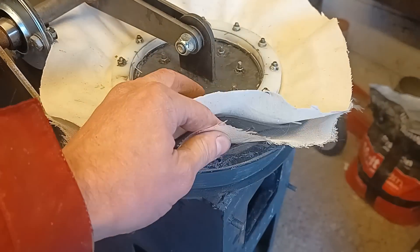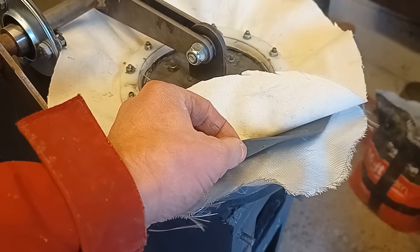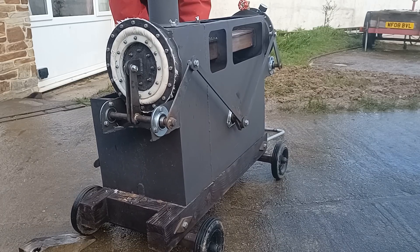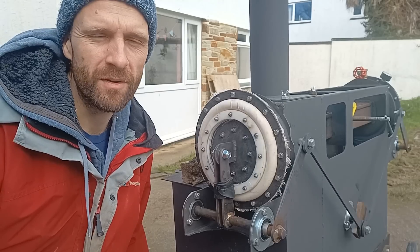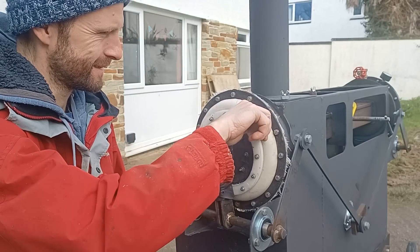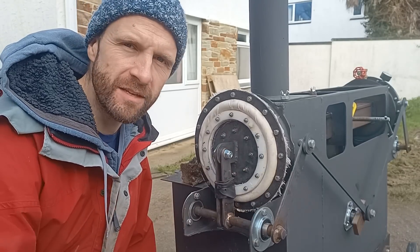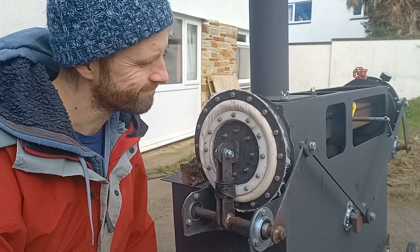This is the next one to try. On the inside I've got the fire blanket which is a glass cloth; in between I've got two-millimeter natural rubber; and on the outside I've got some cotton canvas. I'm hoping the cotton canvas will support the natural rubber from the pressures within the engine. We're up to an hour and a quarter now and still going strong. There was a bit of smoke coming off this earlier — I think it's because the natural rubber has hit its temperature limit, but the canvas is actually supporting it so even though it's probably breaking down and gone a bit soft, the canvas is just holding it in check.